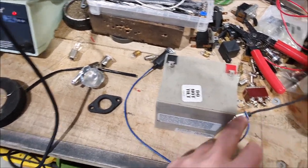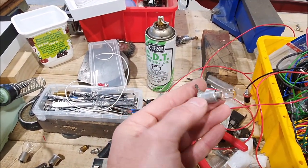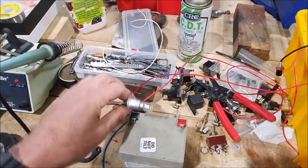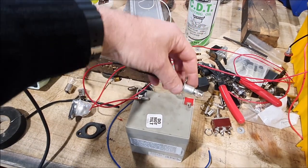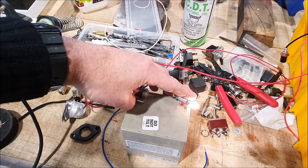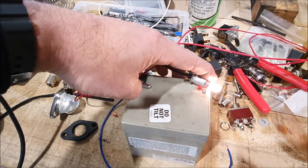You're not allowed to have any white light shining backwards on a car in New Zealand. So I went through my box of bits and pieces and found one of these, which is actually a lamp that goes in the back of a gauge - like a Smiths-type gauge. These take a much smaller and more reasonable light-wise bulb, and also not being an LED they're not polarized, so this should work. I thought I'd picked a blown bulb but no, that's okay.